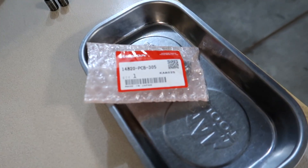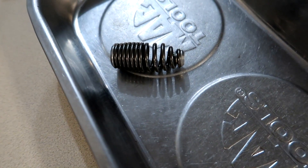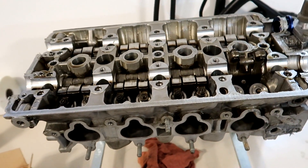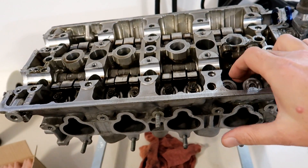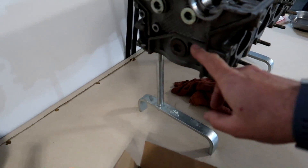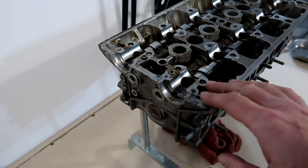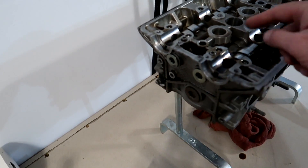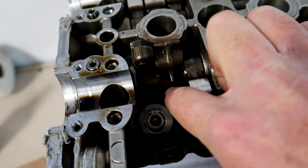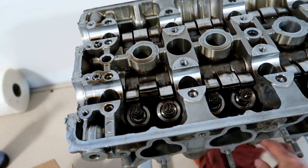This engine was an earlier GSR so it doesn't have the updated lost motion assemblies that Honda came out with. This is the newer lost motion assembly style — it's got this beehive style spring rather than the hydraulic damper that came in all the earlier B-series VTEC heads. I've got to get the valve springs out and then the rocker arms all have to come off. The way you do that is through these two holes in the end of the head. The shaft will slide out this way, and that allows you to actually pull the lost motion assembly out of the head because it won't come out until you remove those — this rocker arm for the VTEC lobe is in the way.